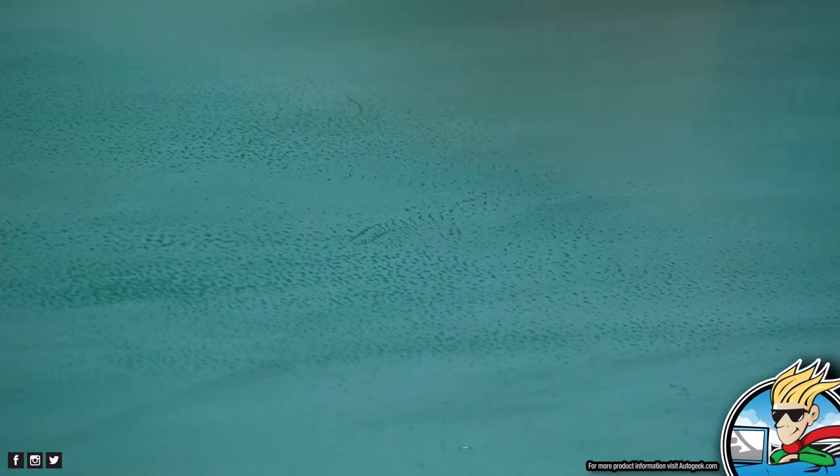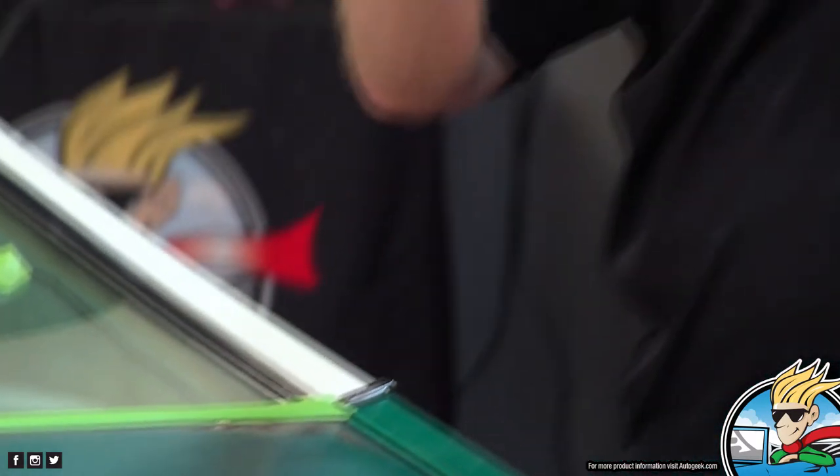What pigtails are is a particle got trapped between your orbital polisher, the face of the sanding disc, and the paint. Remember, most machine sanding is done with very small orbit tools, 3/16, 5/16, 6mm, 8mm, I think the Scorpio might be 10mm. But in context, these are small. When your sanding disc is spinning and making an orbit inside that circle, it grabs that piece and just makes that orbit. That's what's called a pigtail. It looks like a curly Q off a Porky Pig.